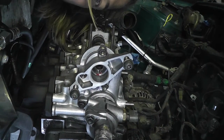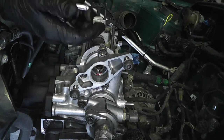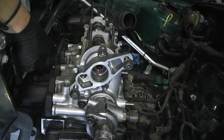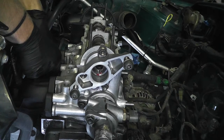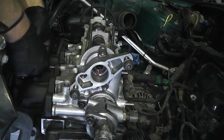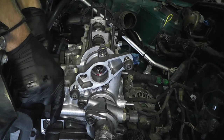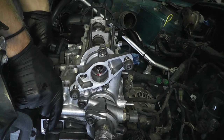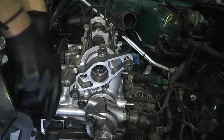I don't know if the rubber mallet is necessary but those little guides — it was just a little tight to fit on. I pulled these studs; the new head came with these basic little hex studs. I originally had them in here but it was just not lining up easily, and I'm really afraid of dinging the surfaces since they're perfectly mated and I want to keep them that way. So I pulled them out and I'll re-thread them to keep the header running. That feels good to start.